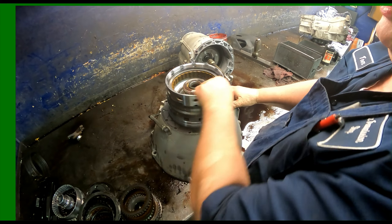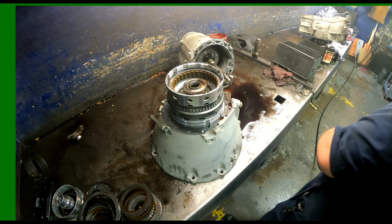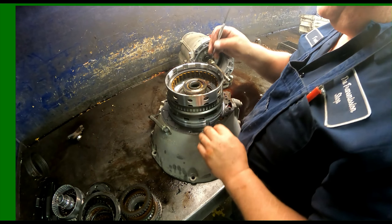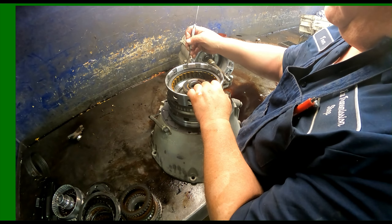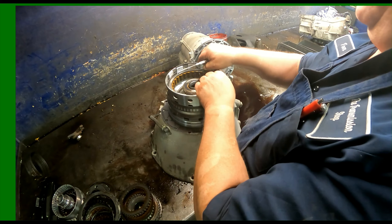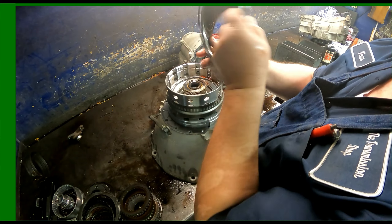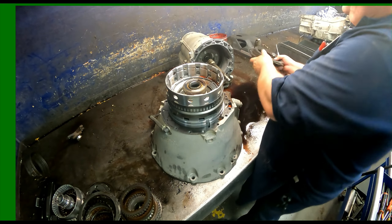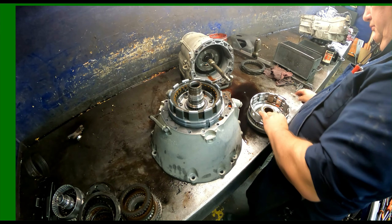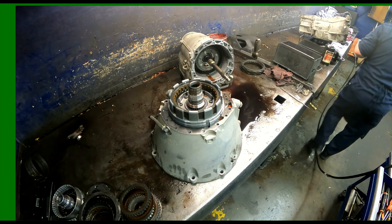Check our sprag — make sure we're turning in one direction, locking the other. These are fairly bad about going out anyway. You might want to take them out of there and shake them and make sure none of the elements fall out. It's one-sided. I'll take that out — yeah, I'll take the part now.